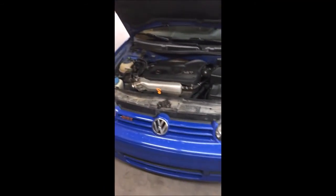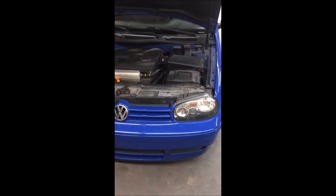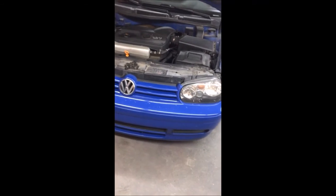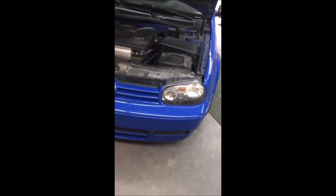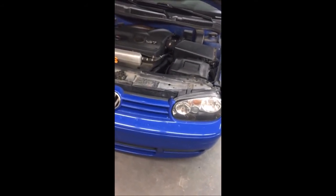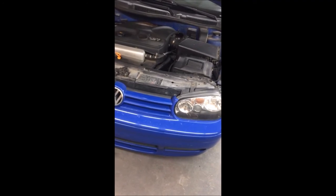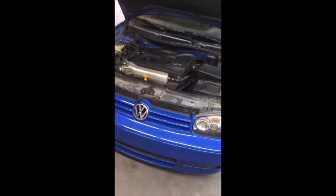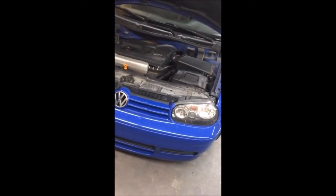So basically, after you get your ECU all cleared out with the engine codes cleared out, what we'll do from there is I will take the car out for a drive. I'm going over to my parents this evening, so I'll have about a half-hour, 40-minute drive to and from. So at least drive it for, I would say, 20 minutes, because that will give the engine time to recalibrate, and it will see any faults that'll be thrown in that time.